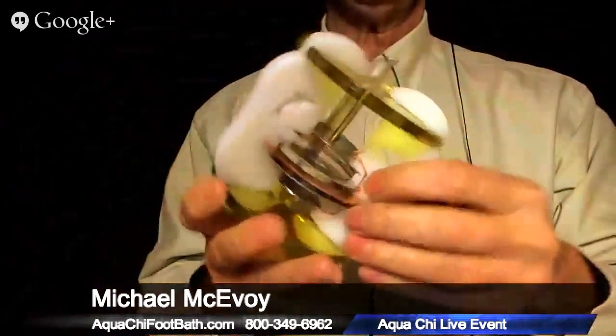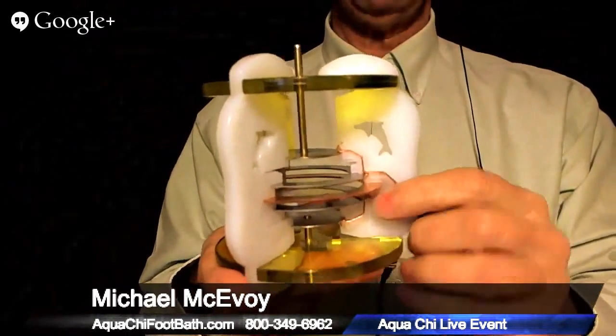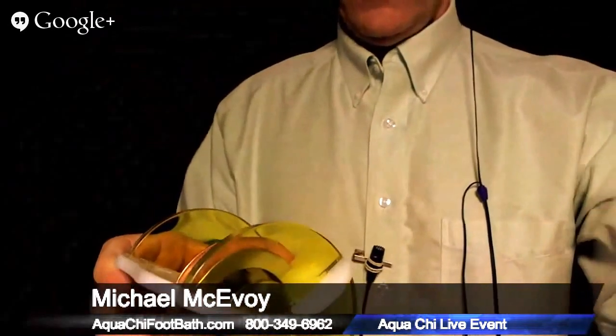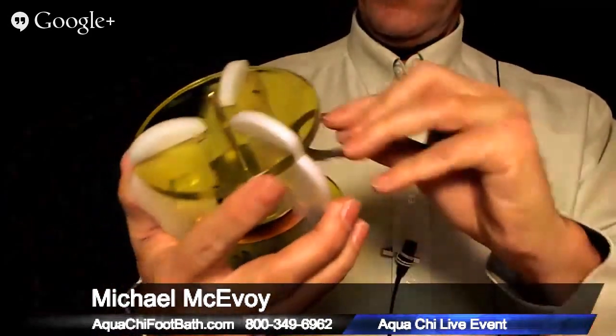I make one more check. Again, this is the key, making sure that all the rings are touching on that white leg with the copper strip. And if it needs another tap here or there to make sure they're in, do that. Otherwise, you're ready to put your ring set back in. And go ahead and do that.